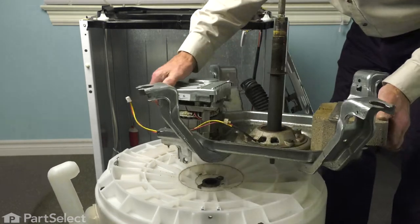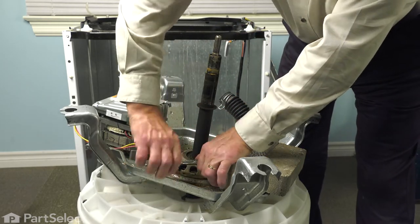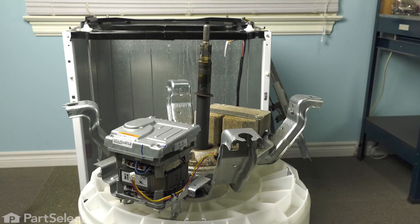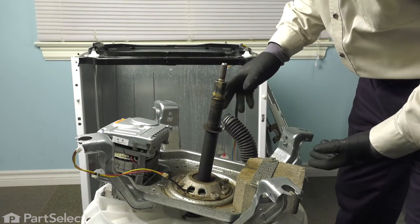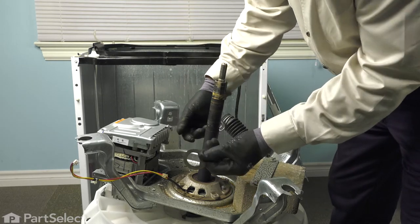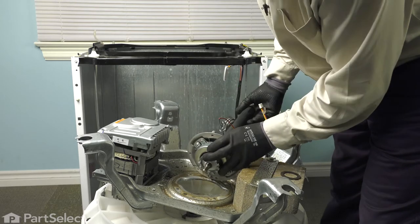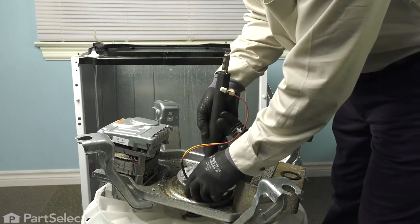If the bearing looks fine, we're simply going to turn that assembly upright. Next, we'll remove the remaining three-eighths bolt on the bottom side and also remove the last wire tie clip — using needle-nose pliers, squeeze the tabs together and pull it out. With the harness removed, we can then remove the old tube assembly. If the bearing washer was stuck on your old one, remember to keep it aside as you'll need it for the new one. Just lift it out of the housing, discard it, and place the new one in position, making sure the harness is pointed in the right direction and that the two bolts from the bottom fit into those two slots to help align it.